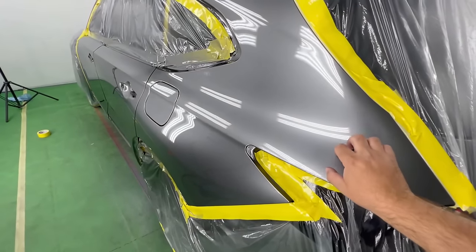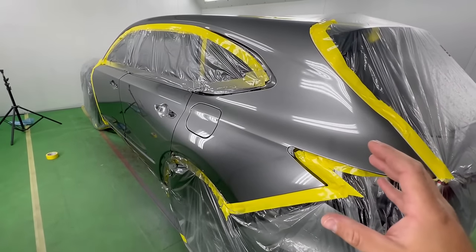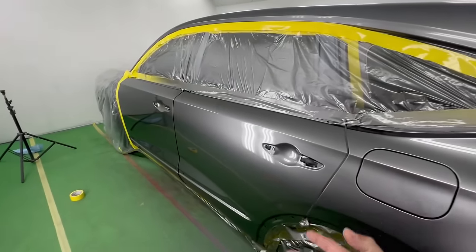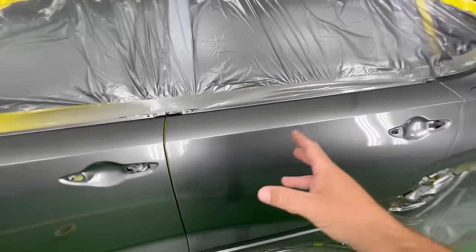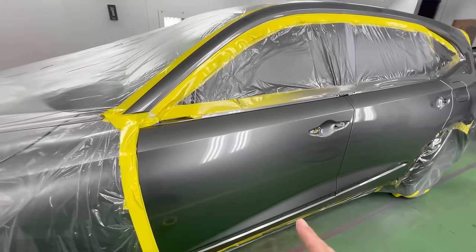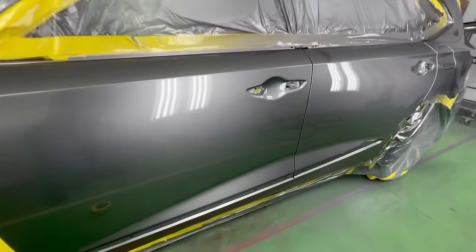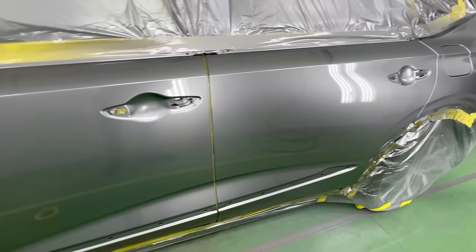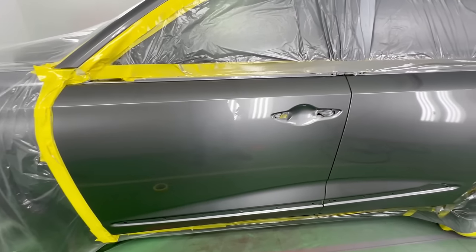Oh, back here the next day, she's all dry. And the most important thing for a painter is looking good the second day, and it has to do with the actual application of the paint, right? So if your paint is looking good that first day, it might not look the second if you really poured it on. So one of the things I liked about the Series 2 is that it atomizes the paint before it hits the panel.